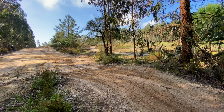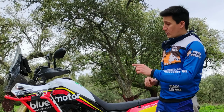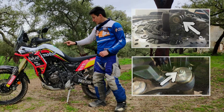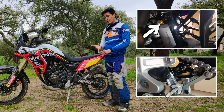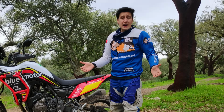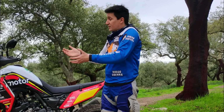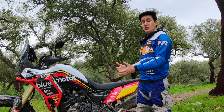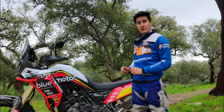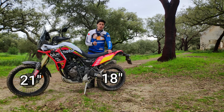But moving on, let's talk about the suspensions. The front fork is two-way adjustable, meaning that you can adjust the compression and the rebound. As for the shock in the rear, it's three-way adjustable, so you have compression, rebound and preload. Since Yamaha was kind enough to give us a bike with these three adjustments, the least we could do is to learn how to adjust them, even if it's only on a basic level. To help you with that, my next video will be a tutorial about suspensions in general and how to adjust them on the T7.